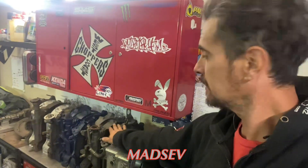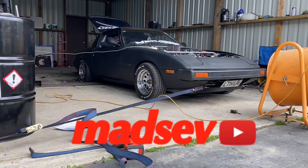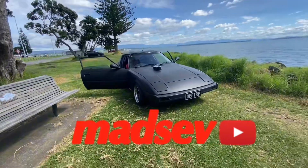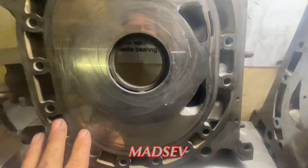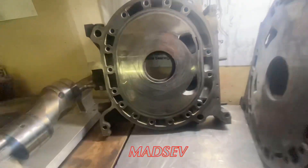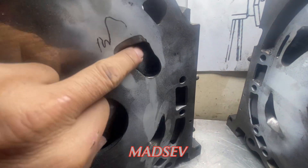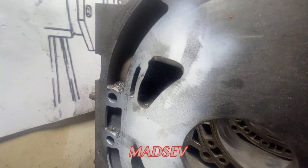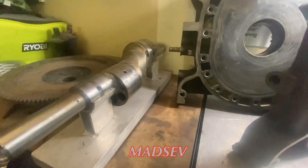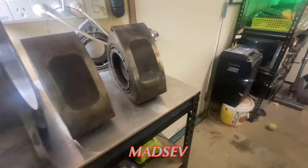Today I'll be going over these housings, checking those over, and hopefully getting these painted. I've been tinkering away at this engine for a little while now. All the porting's been done, all the supports are done, these have all been extended up, cut the bridge into there. This is a secondary bridge port so the centre iron doesn't have a bridge port at all, but it's all been extended up. We've got the port on the rear iron. I've got this e-shaft here that I need to check, and I'll go through, clean all this up, and go from there.